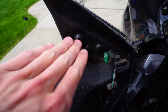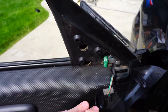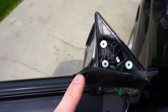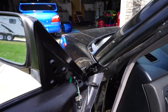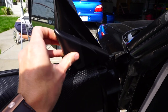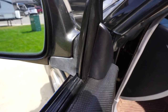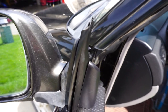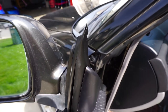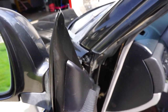I like to put stuff away clean, so we're going to get some Fantastic and clean this up, then put some protectant here. Then we can close this back up and I'll show you how to seal this part on the gusset. Now that we got everything protected and put back, it's time to put back this little piece and fix the other spot. You can definitely see the difference it makes when you squish the metal together - there's a little bit of gap here and there, but I'd much rather have a little bit of gap on the trim than wind noise.